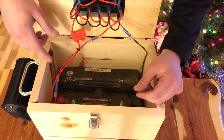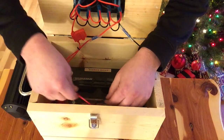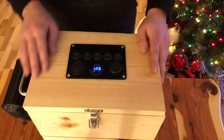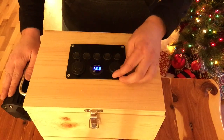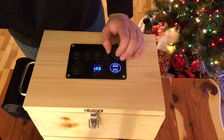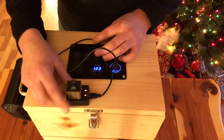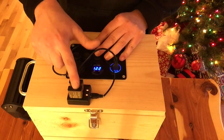Everything is with heat-shrunk connectors, which I still need to put some heat to. I ran little eyelets to go over the posts on the terminals, and then I'll have wing nuts. It now shows our readout and we're reading 12.6 volts. We have five rocker switches — the only one I have hooked up right now is for the LED light. Our USB charge is ready to go, so I can charge my phone or my cameras. For example, these are the batteries to my GoPro action camera — they're charging right now, and this is already regulating the voltage and amperage to the charger in the correct manner.